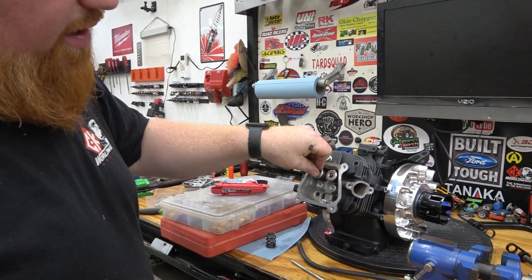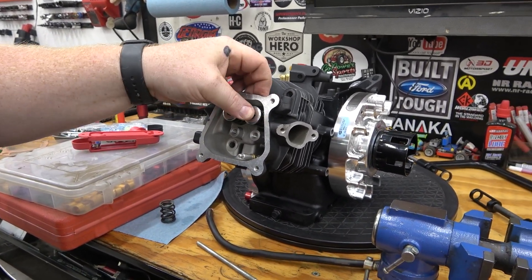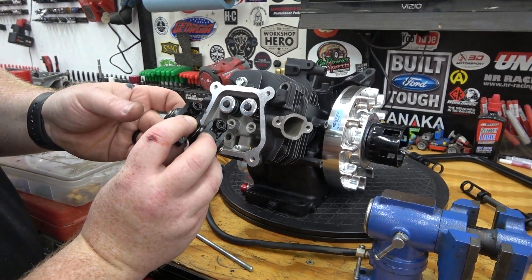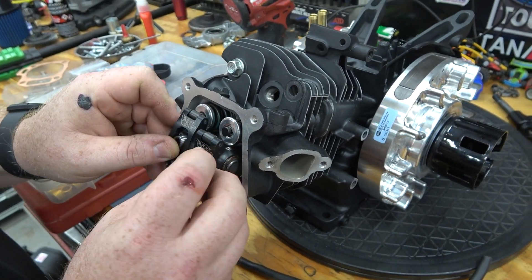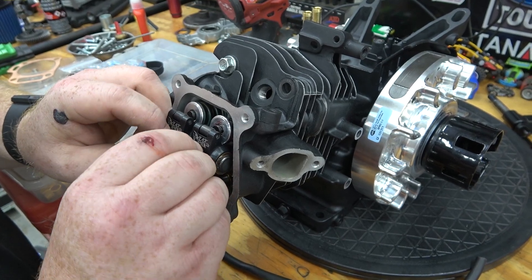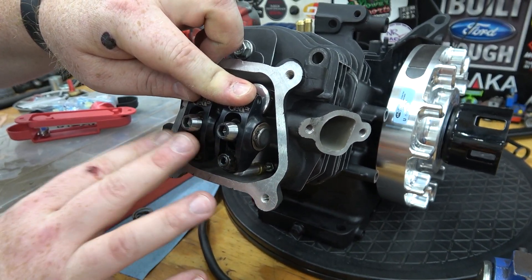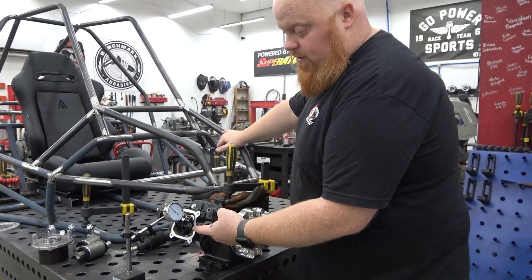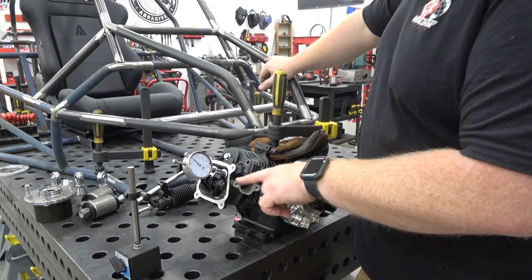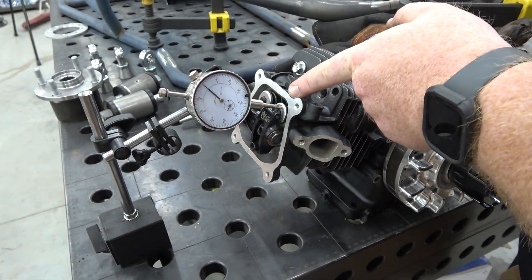It's very important to put on your lash caps. We're running Go Power Sports heavy duty lash caps made for use with these retainers. Get both rockers started and make sure to seat your push rod properly. You can use wood clamps or whatever you have to hold things down. Go ahead and tighten up both sides and make sure your lash cap is on.